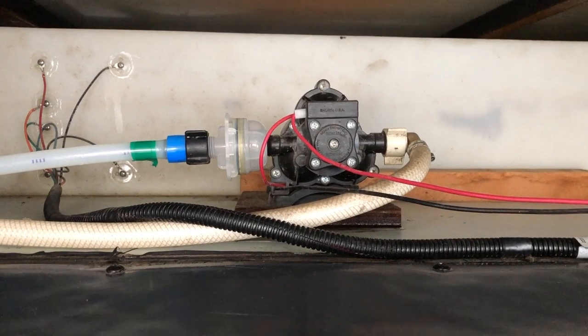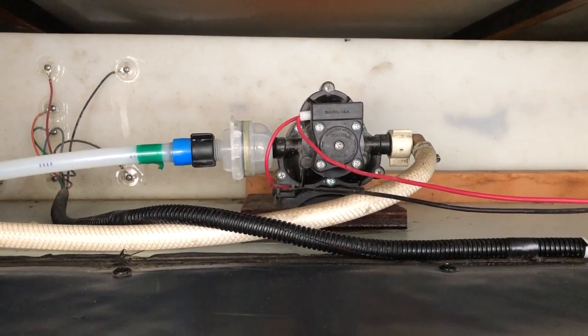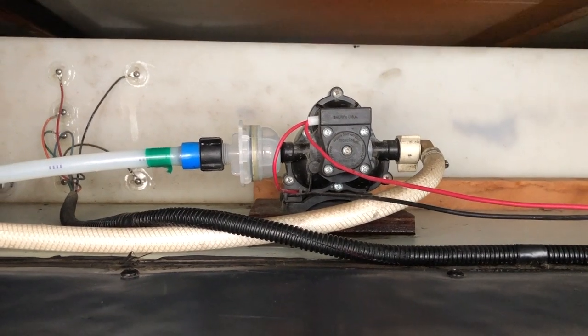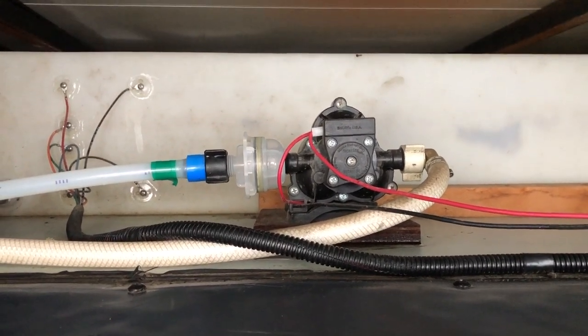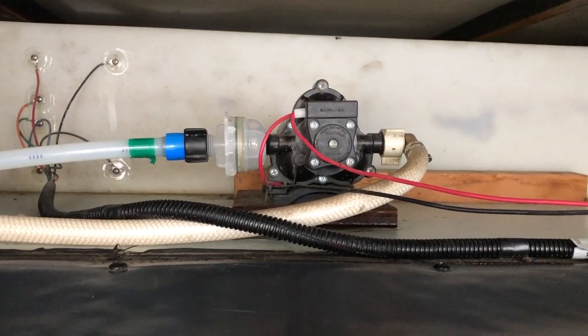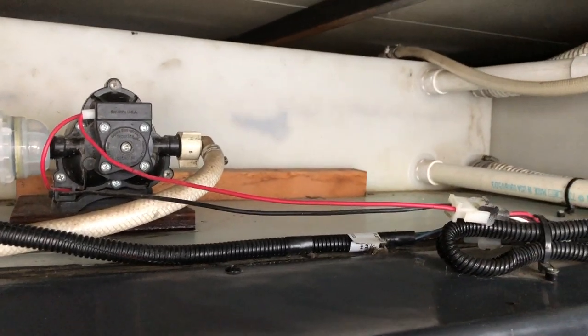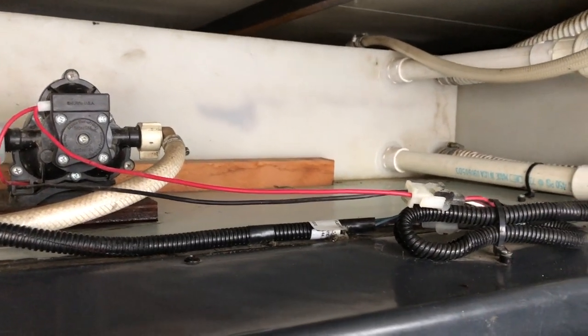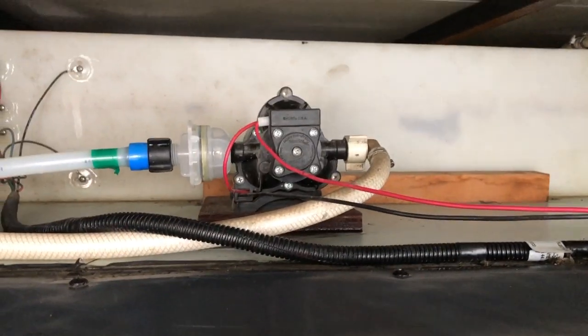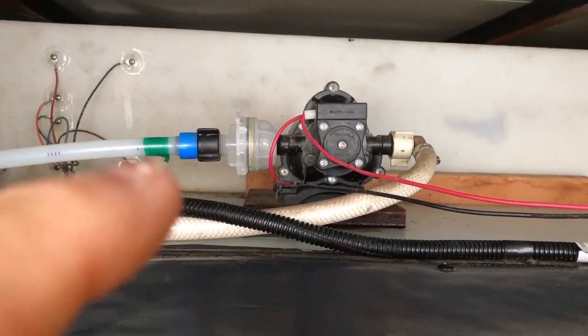Definitely needs to be taken off. You need to inspect it, look at it, clean the strainer. A lot of people don't know about that. So stay tuned — this is a quick video. I'm going to show you exactly what to do. First off, make sure there's nothing drawing water. Feel free to disconnect the connector right here for power if you so choose. But more importantly, this hose here comes off — it's a half inch.